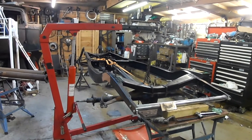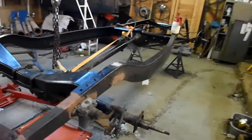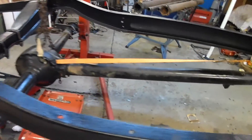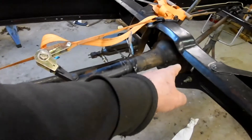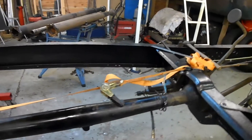Hello, welcome to Mark's Garage. I've been messing around with my 32 frame and chassis and rear axle — ignore that shock absorber, that's just something I was playing with. I've shortened the torque tube and got it tensioned up with a strap sitting on a mount there, bolted on. So there's the torque tube which I've shortened.